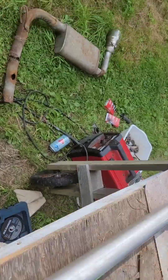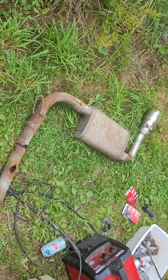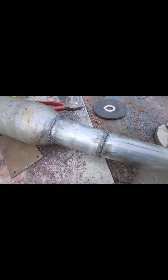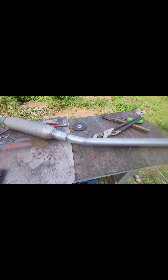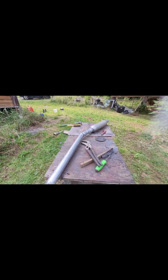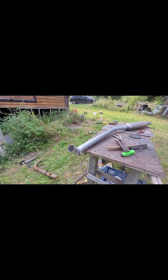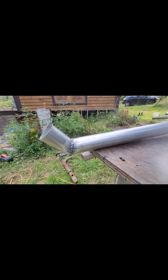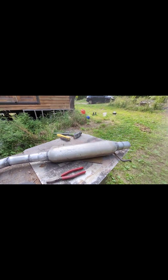I have to add a little piece and then cut and dress this one up, then I'm ready to fit a couple more pipes. There it is — done and welded up, nice bend there. Looks good up there at the adapter, ready to go. Nice little curve — looks factory. I think this piece is like 300 bucks or something ridiculous including the resonator — pipe guys are scam artists. But look at that, real nice angle, should receive the other one good. Got an old Magnaflow muffler to put back on.